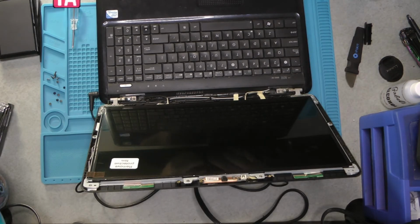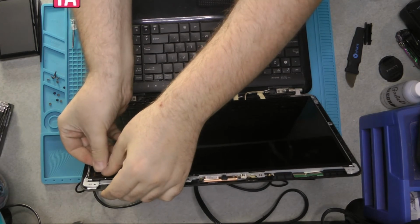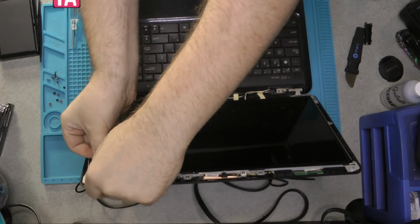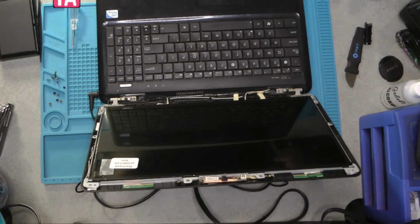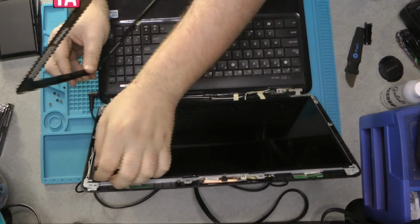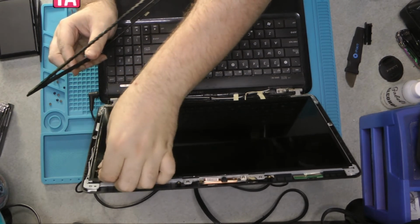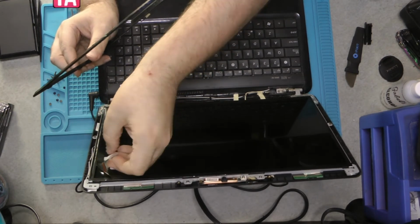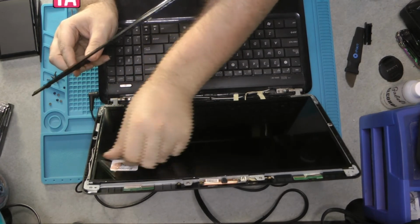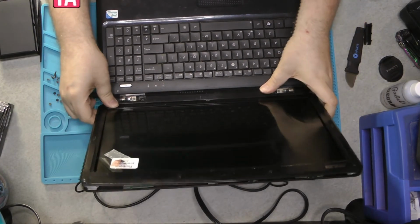Okay, first thing we're going to do, so we can keep the protective film on there as long as possible, we're going to pull this tab over and lightly tape it down onto the film so it doesn't get in our way, and we can pull it up after this bezel is on, because this bezel will line up to get nearly the entire thing out. Let's see. Need to pull it down a little bit so this one corner will be revealed, but if we do this, most of the screen should be protected while we're working on it, so nothing bad can happen.